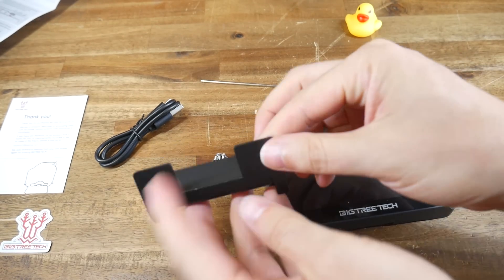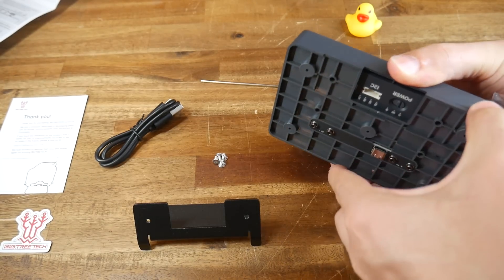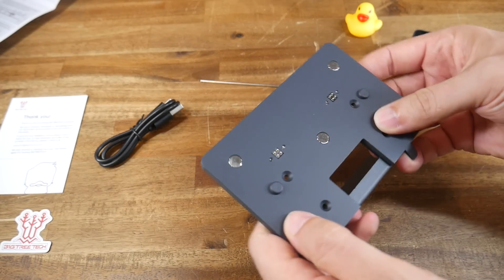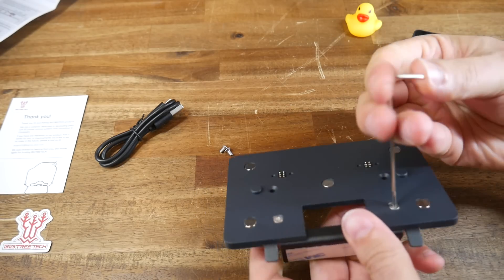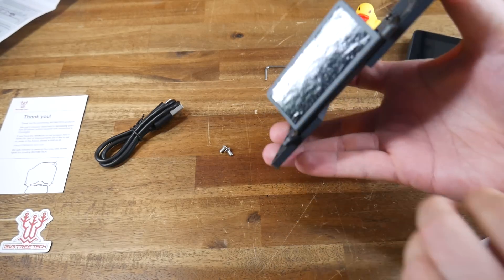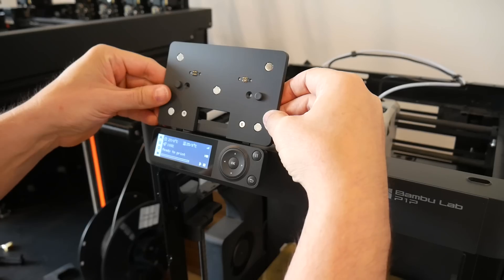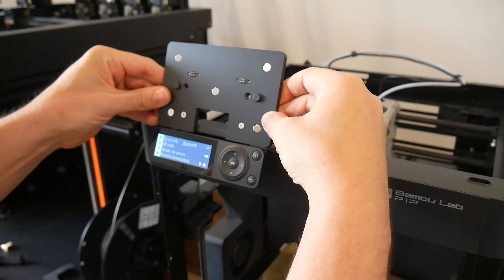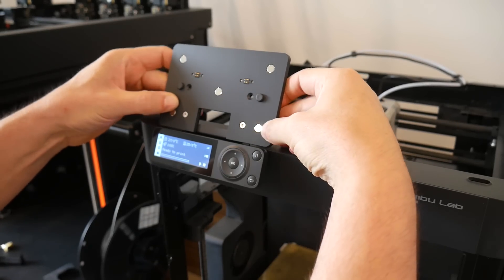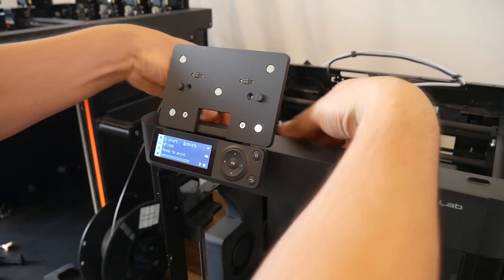Physical installation is extremely fast. We take the metal bracket, remove the dock from the back of the Panda Touch, align the bracket with the holes and cutout on the back, and use the included countersunk M3 bolts to attach the two together. We then peel off the backing from the sticker on the bottom, ensure the mounting location is clean and dry, and carefully stick the bracket down in line with the default display on the P1 series. You could stick this base on any other surface or printer, but this would be the typical install.